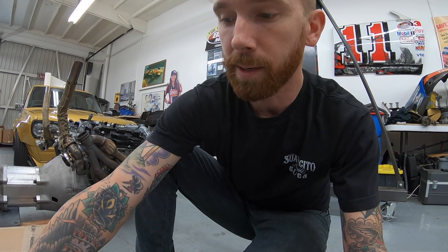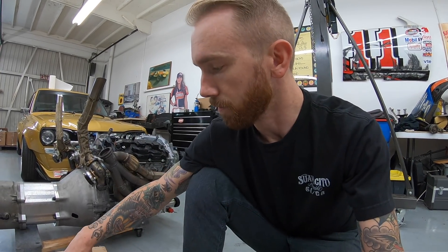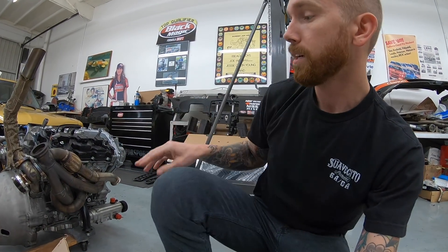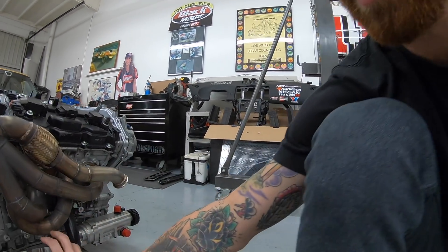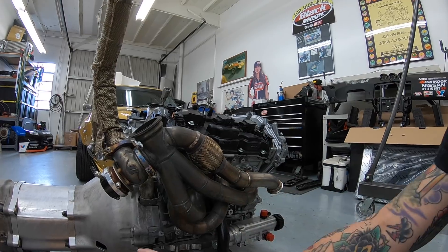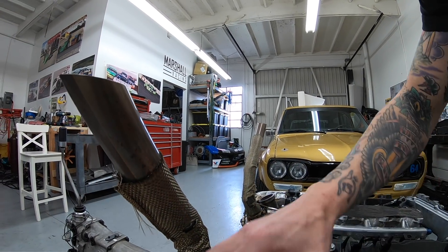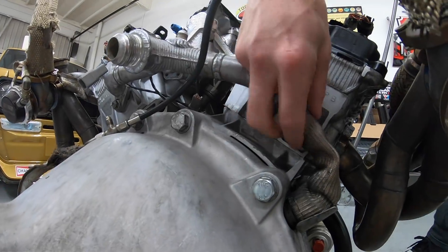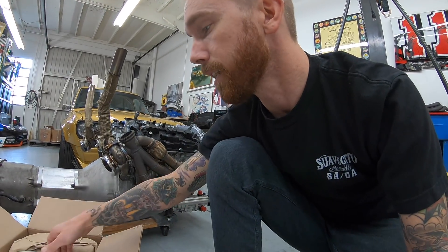They're not really a cheap way out for a race car. The nice part about these manifolds is that they have short runners, they flow very well, it's a tubular design that is casted — it's not just a log manifold. So you have a very durable product that is very close in orientation. It keeps the turbo tucked nice and low right in this area instead of up and back, so we get the weight nice and low, we keep the heat down and back, and we don't have issues with all of our coolant setup having so much heat generated up in this area.